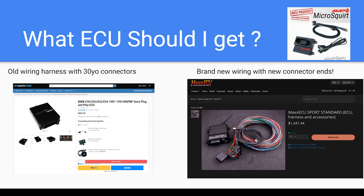In a more basic build, plan on at least a few hundred dollars for new connectors and related parts. So these are your options — this is just to get your feet wet. Essentially there are two types: you'll get a plug-and-play or an ECU with a drop-on harness specific to your motor, where you just wire it up and it's done; or you'll be building your own harness with flying leads, getting a reel of wire and connecting everything to their respective sensors yourself.